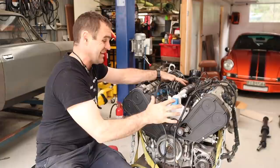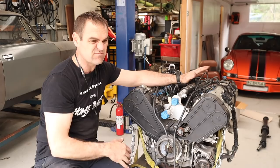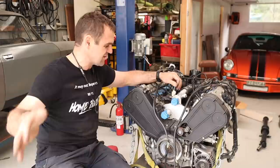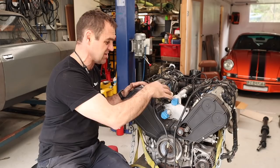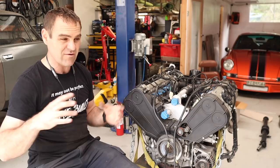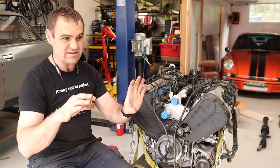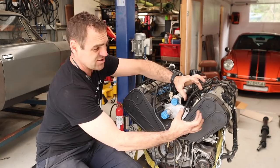After a lot of head scratching, I've managed to plug in all of the Ferrari loom again and worked out everything I'm going to use. Thankfully this engine doesn't actually have too much extra fluff like the Audi did — all that extra emission stuff that was much more complicated. This is surprisingly a relatively simple setup. It does have variable valve timing, same as the Audi. For those who never understood how it worked — I knew it changed cams and I thought it would sort of slide the cam along or change to another lobe, but that's not actually how it works at all.